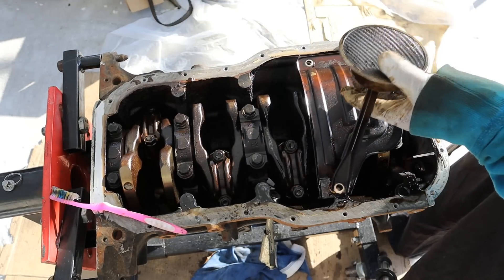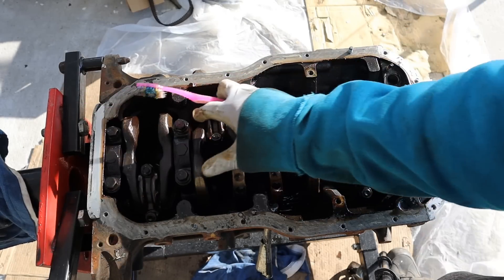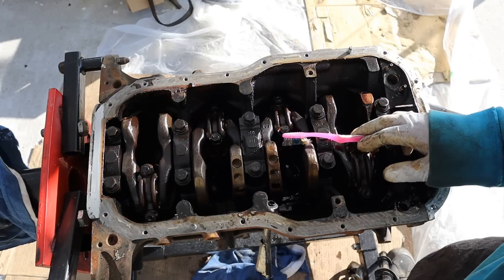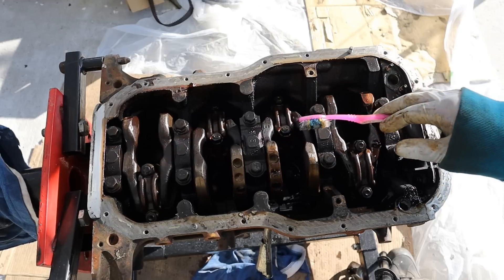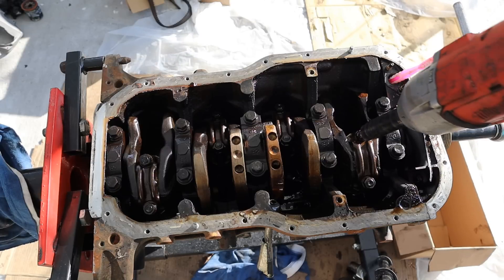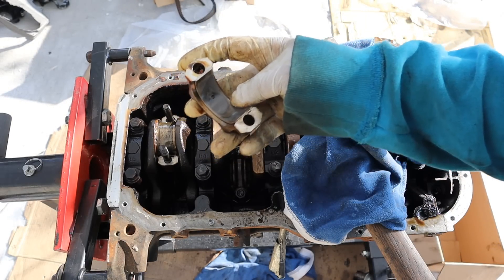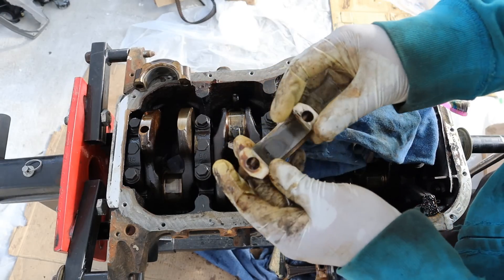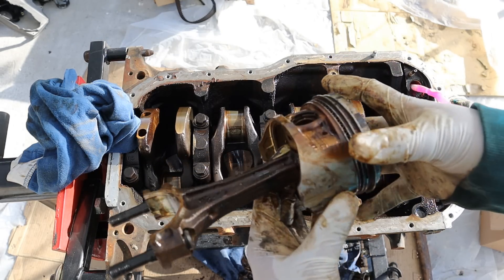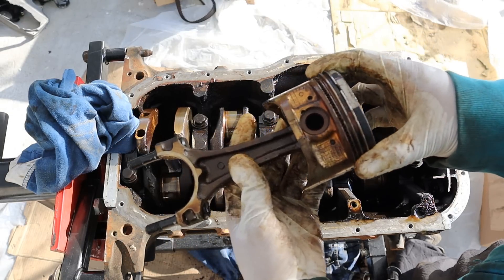I'll get the little pickup tube off. Taking a look at the crankshaft layout, just like many other 4-cylinder engines it uses 5 main bearing caps. You've got counterweights on the opposite side of the connecting rod caps to cancel out some of the rotating mass and vibration. If you step up to the 2.2-liter 5S-FE Camry engine, that one has a balance shaft built in because that application doesn't make as much power and is expected to be more smooth and refined. I'll start removing the connecting rod caps. It looks like we have a big heat spot. Number 3 looks the same, no abnormal wear. Number 2 looks good as well. Looking at all the pistons, I don't notice any abnormal wear. These older Toyota engines are just so meaty and heavy — it feels like it could take a lot of power, especially given that this engine also came turbocharged.